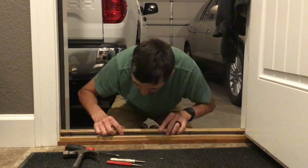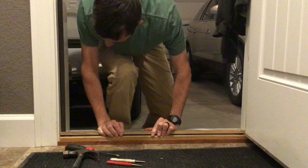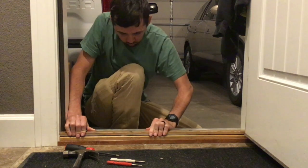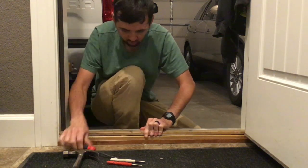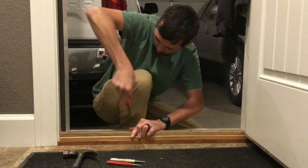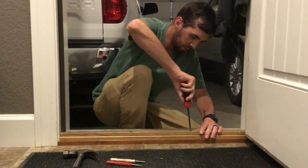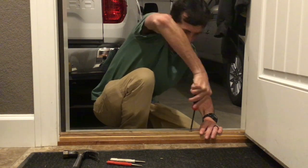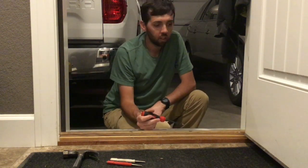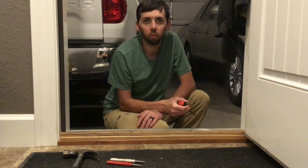So what we'll do now is just get it back into its guide, which is kind of tough with the weatherstripping on one side, but if you just manipulate it a little bit and get it to sit back in there, then simply put those screws back in the holes and tighten it up just like that. A good rule of thumb: get all these down to where you want it, close the door, see if there are any gaps, and then raise it up accordingly.